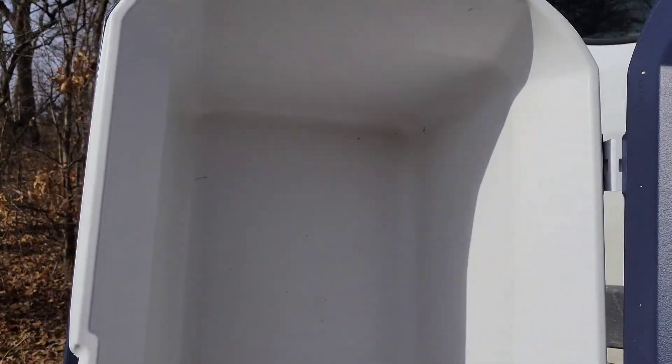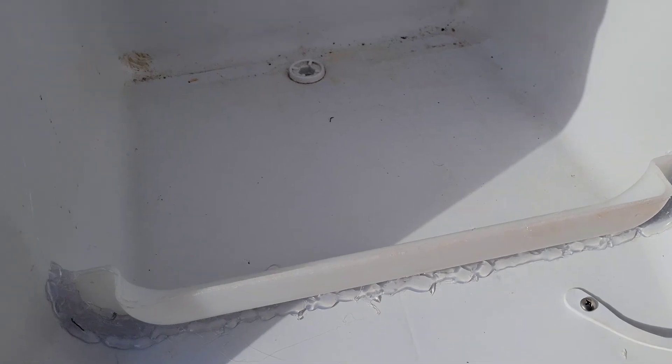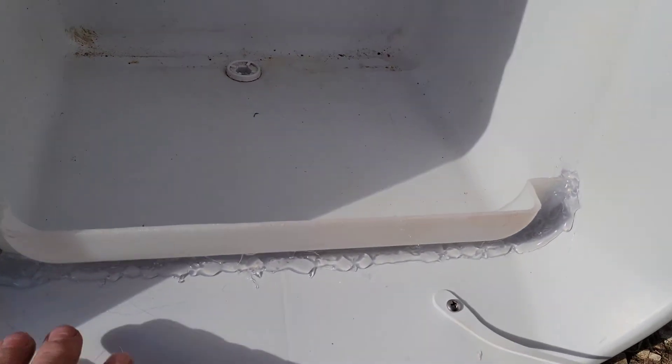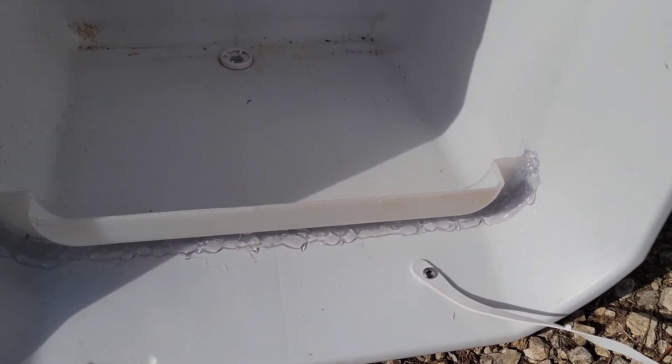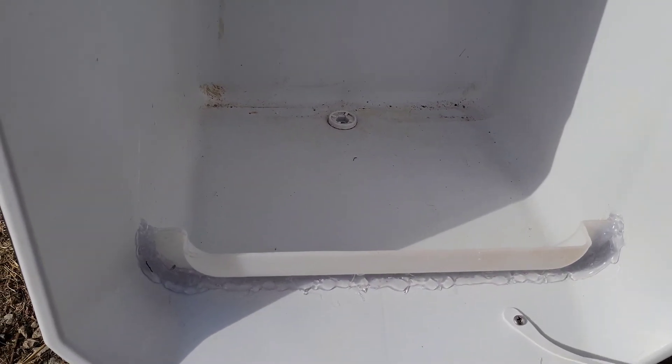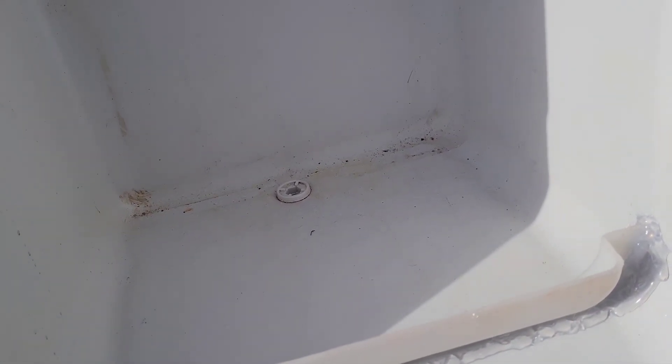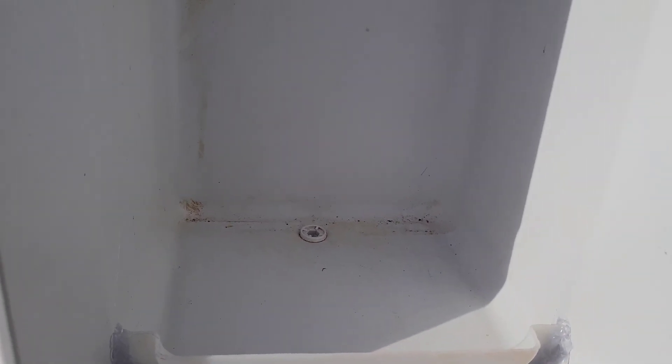You can see it's set up right like this. We're in a van, and as the ice melts it's going to create a pool of water right here. I experienced this in my other vans when I was using a cooler as an icebox — I always had a little drip coming out onto the floor that I kept having to wipe up, and I thought this would solve that problem totally. Just hook a drain hose on the outside of that drain, running straight out onto the ground. I'll be able to build shelves in here — it's only critical to have this bottom water tight. The rest is just insulated protection to keep things cold.